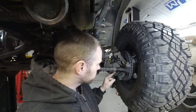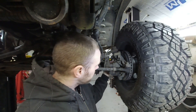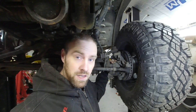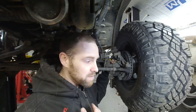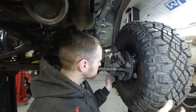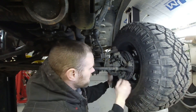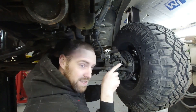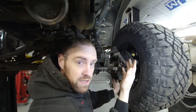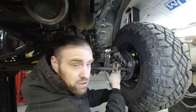You can see we're at the front axle right now. Here's the tie rod end, and this is a U-joint as well. This U-joint right here has an extremely high failure rate, because of the angle at which things turn. Every time you turn the wheel in a parking lot or anywhere with a tighter radius, it changes the angle at which that joint is sitting. As this is rotating going around the parking lot, this thing will bind — which is normal to a certain extent, but the more aggressive it is, the faster it will wear out. That's why these things have such a high failure rate.